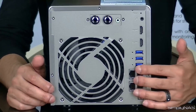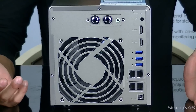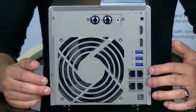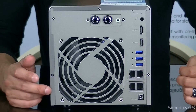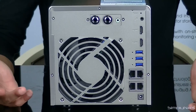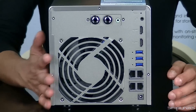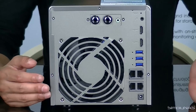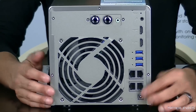Down here you've got four RJ45 ports — this is fantastic. It allows for major bandwidth and you can aggregate two in two. You can assign two ports to your QTS and two ports to your Ubuntu, so each OS can have its own network bandwidth and throughput. That's fantastic for performance — it means if someone's doing something heavy on the Ubuntu side, it won't hurt the QTS side.